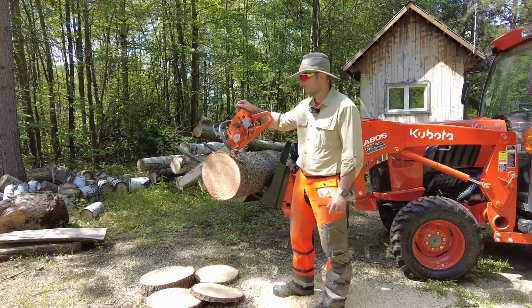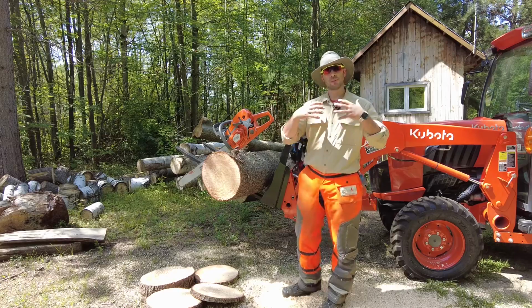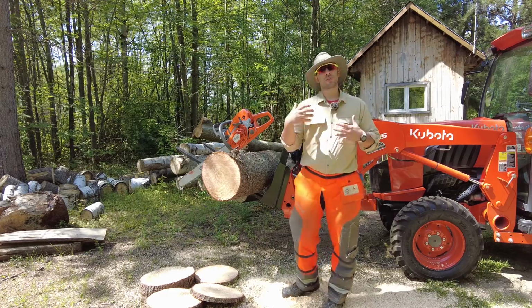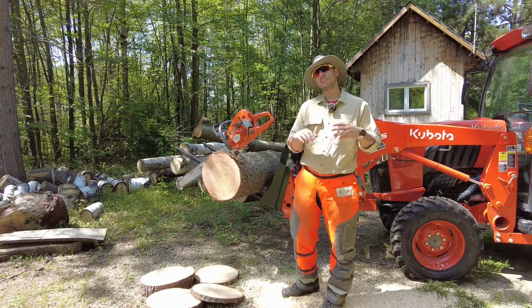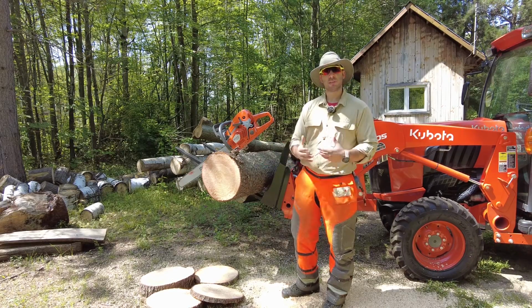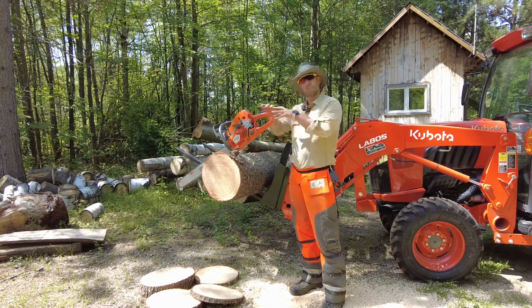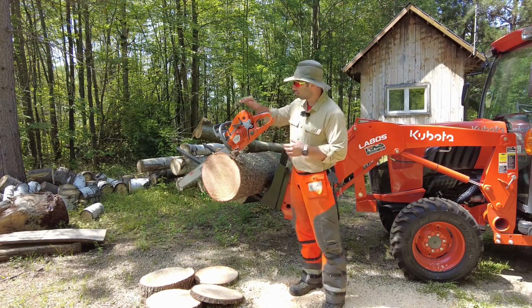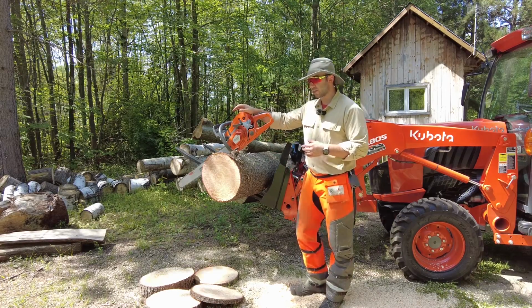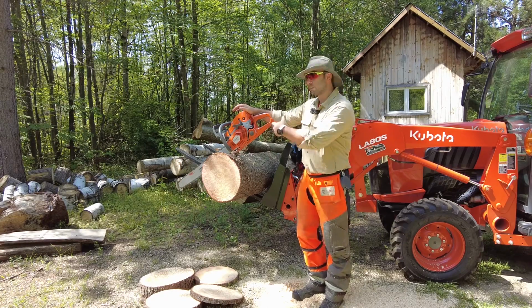This saw just woke up again. Now this saw is tuned to my region, to my environment. If I was to start it tomorrow, because today is very, very warm and humid, it would probably need a bit of time to readjust to the atmospheric conditions. But I'm guessing that now the big tune is done. Now the fine tuning is where this saw will shine, because I think they said it senses and auto-tunes itself 10 times per revolution of the piston.